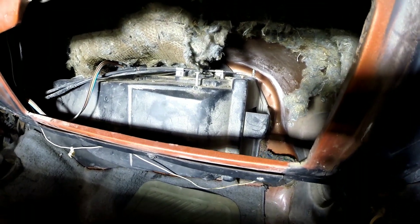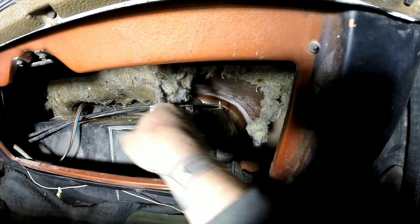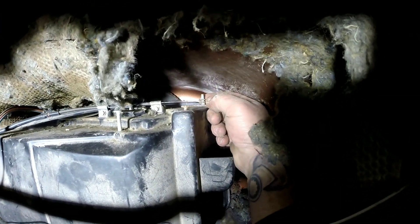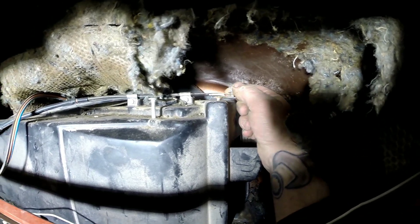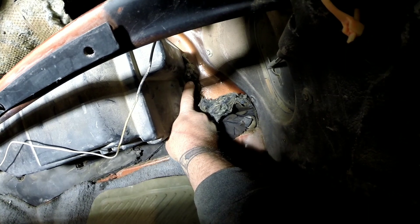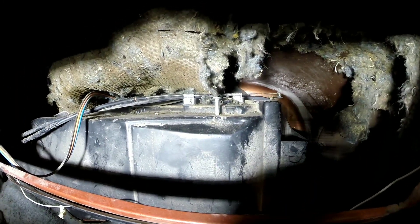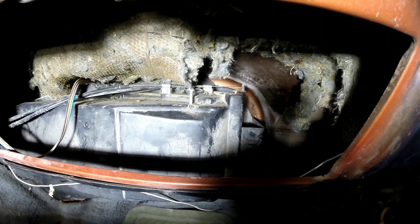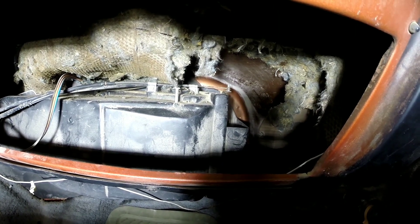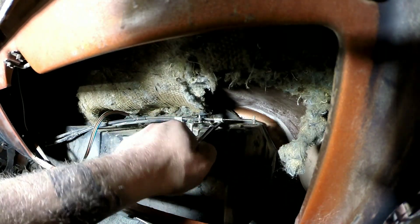On this one I won't need to worry about that because my glove box is broken and it just removes like that. You'll need to disconnect and take these screws out here for your cables — it's got these little clips that just hold the cable on the damper door. Remove those clips. On the inside I believe there's a screw here and a screw there, and I think the other two you access from the outside. I need a 9/32, at least that's what this one is — take those loose.